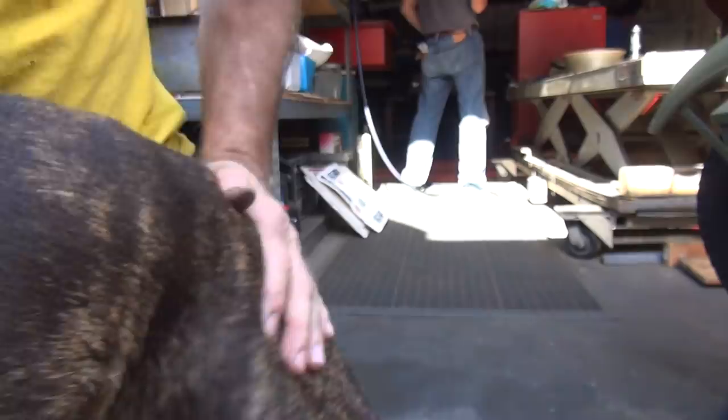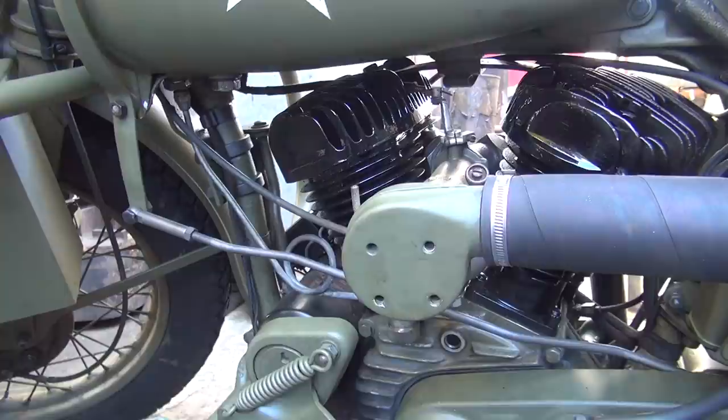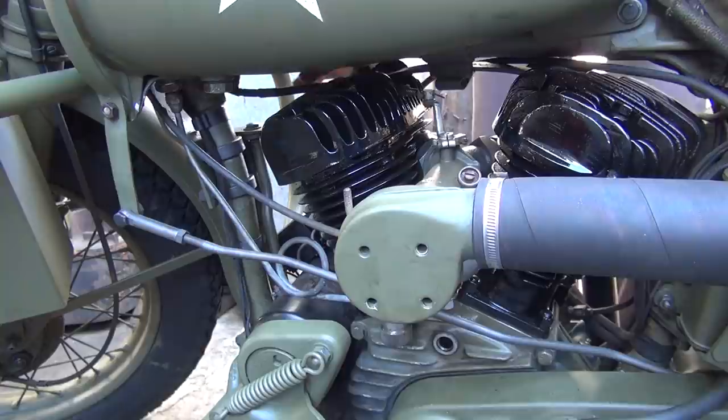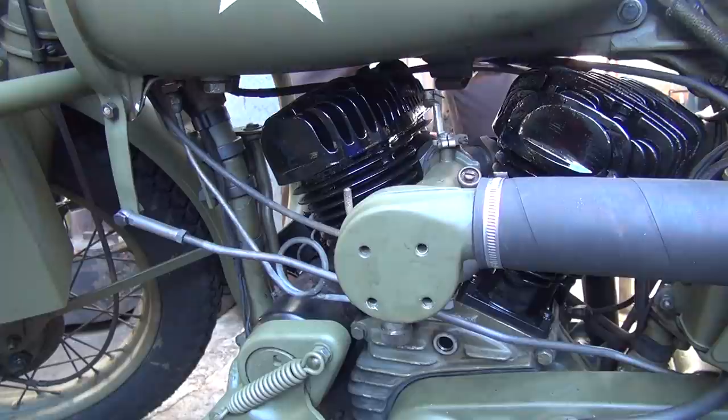Okay, somewhere there's a timing mark down in that hole down there. Okay, we've got to figure out what compression you're on right now. You on the right stroke? All right, we're on the compression stroke. Okay, it's on the compression stroke. Advance the distributor as far as we can go. Where's the plug at? Okay, you need to tell me when this thing sparks.